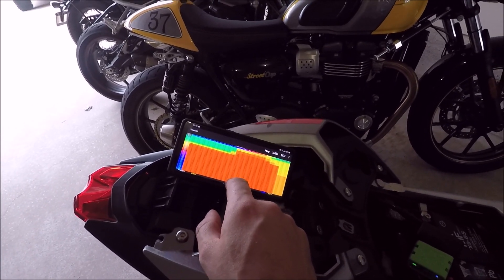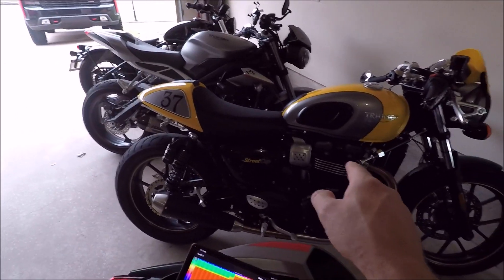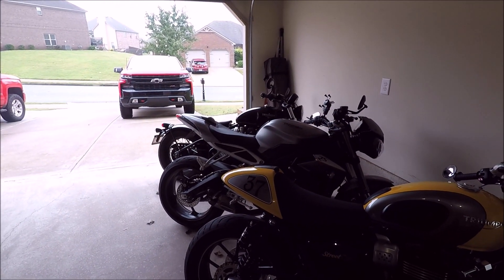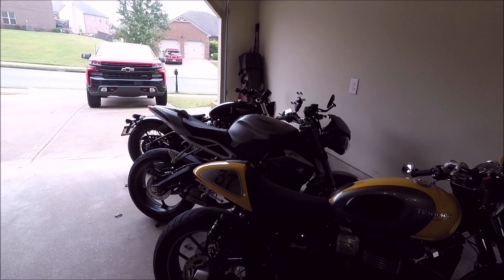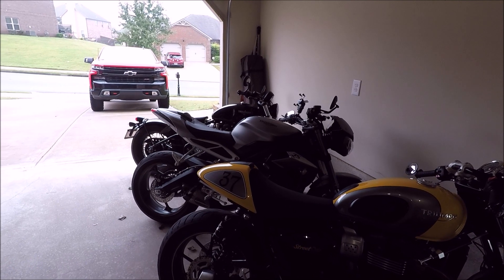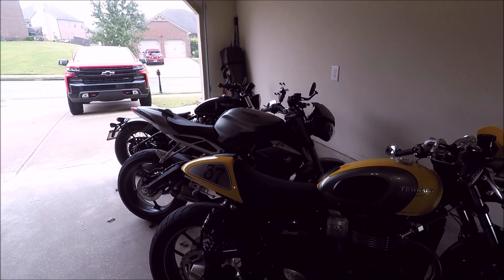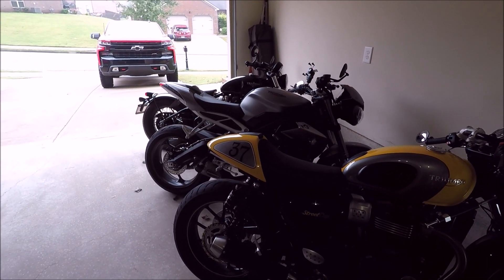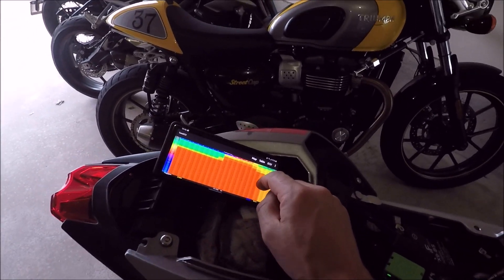This video is about how to flash the ECU. These are the changes I made — extended the rev range and adjusted the air-fuel ratio a bit. We did something similar on a bike with a cam and exhaust that was actually dyno mapped. The bobber at the end was able to get tuned courtesy of DNK Tune Works — she's got a lot of cool maps for a lot of setups. If you don't have access to a dyno or don't want to invest in a Power Commander, hit up DNK Tune Works and see what maps she has for your bike. That woke up my wife's Bobber 1200 — it was holding power back in a couple of gears, but now you twist the grip and it gives you full throttle. It's a hoot in a straight line, still doesn't corner because of the ground clearance, but it really transformed that bike.